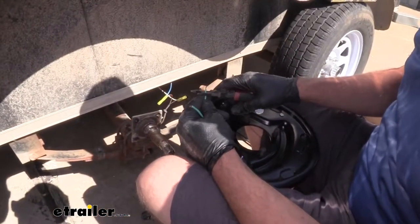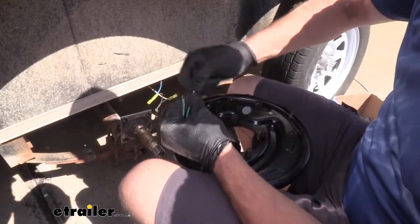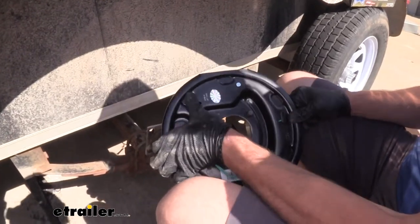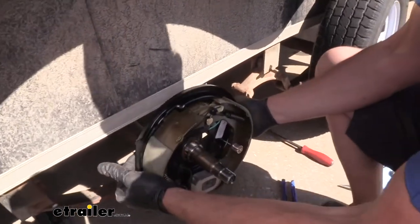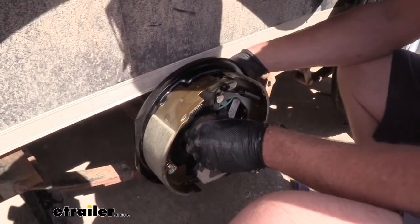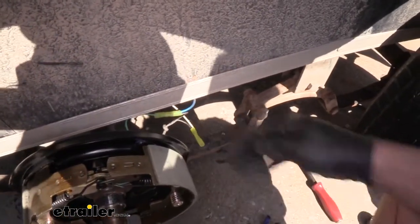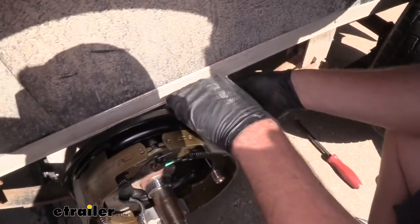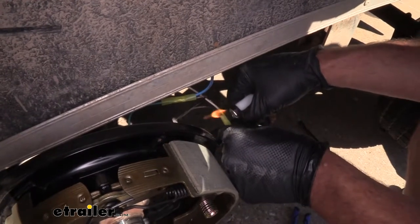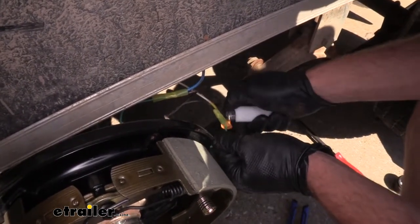I'm just going to strip back a little bit more here on these wires. I like to double these over since we're going into a little bit bigger butt connector. Now your assemblies — since you've got left and right — you're going to use the left hand on the driver's side of the trailer. It goes right into that original flange, and for now I'm just going to throw one nut on it to hold it in place while we make our connections. Crimp it down, then we'll use a heat source to shrink them — we can use a lighter, a heat gun, or a mini torch. We just want to be sure we don't overheat them; you don't want to melt the actual butt connector, you just want it to shrink down. As you start to shrink it, it's going to turn kind of clear and the wires are going to look like they get a little bit larger, almost like they're magnified. There's a little bit of clear gel that comes out of the end, which gives you a really nice watertight connection so you don't have to worry about corrosion issues.